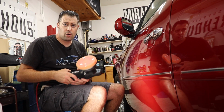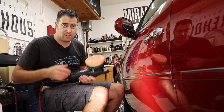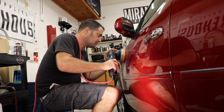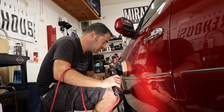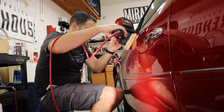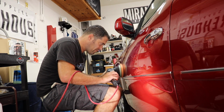Again, if you want to prime the pad, be my guest, but this works perfectly, as you'll see. The polishing process will be easier. No pressure and don't move too fast. Just steady, slightly faster than compounding arm movement. Work the polish until it starts to break down and go slightly translucent. Then you're ready to remove the polish.